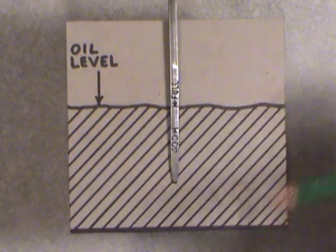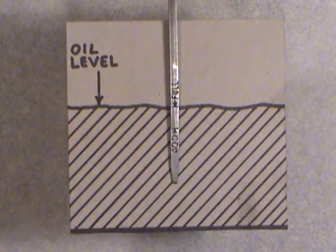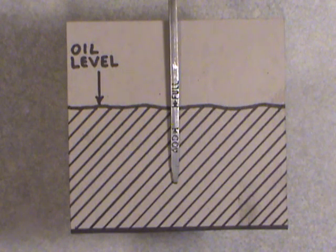If you find, like say you've gone for that long trip, you knew you left home and the thing checked out, you had it full of oil, then you go on this long highway trip and you have an older car, say, well, they generally tend to burn up a little bit more oil. You could have leaky valve guide seals, valve stems, and it's leaking down into the engine, actually burning it. Or you could have different scenarios, blow-by, say your piston rings are worn, and you can get a lot of that going through the PCV system. So if your engine uses more oil, you have to look at it that much more often.